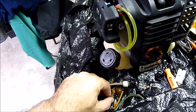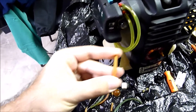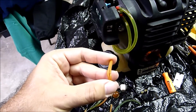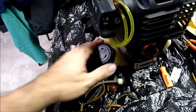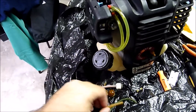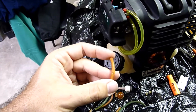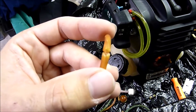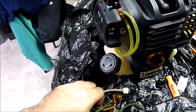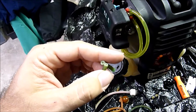Really read through the specs, because some of the stuff — especially with aviation mil-spec hardware — it might be rated for 100 low lead and proven for forever. But with pump gas, you've got to make sure there's enough data behind it that your various fuel system components are rated for it and will work. The tank is a number two high density polyethylene and it's been fine — it's a plastic that holds up to ethanol. But some of these various plastic tubings, which I have seen in quite a few ELSA and LSA planes, some home-builts, ultralights — that kind of stuff — it shows you what ethanol will do. Hopefully this will help the aviation community, and this is definitely a huge safety-of-flight thing to look for on your next pre-flight if you have any history of running pump gas in your aircraft.